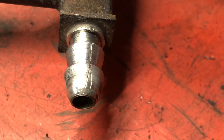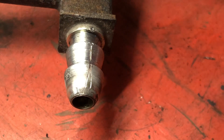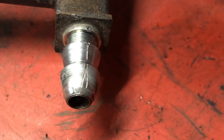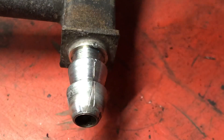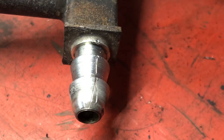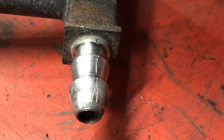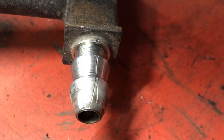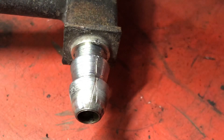This is a classic example of what happens when you use a knife. Look at the gouges in this thing — this is a 1987 car, so I imagine the lines were changed at least once by the evidence here, because it's all chopped up. If I rub my finger over that, it is sharp — I can really feel it. What's that going to do to the inside of the nice new rubber hose when I put it on? It's going to put little cuts in it, and that's going to make it fail early.